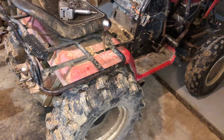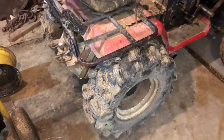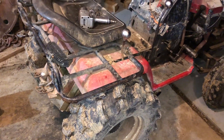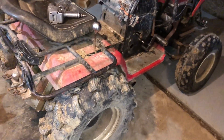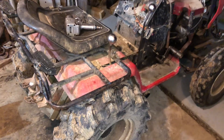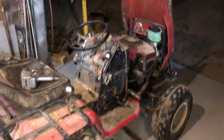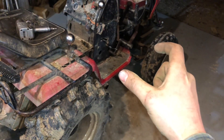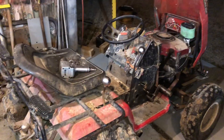I have shift keys coming. My third and fifth gear are not happy — I'll probably have to file the inside of those gears to get the new shift keys to grab good without ruining them. I plan on reverse engineering some shift keys once they get here so I can make my own. Seems like I can make some out of quarter-by-quarter 5160 spring steel, machine them out, and they should turn out pretty good. I'll have to look into that.